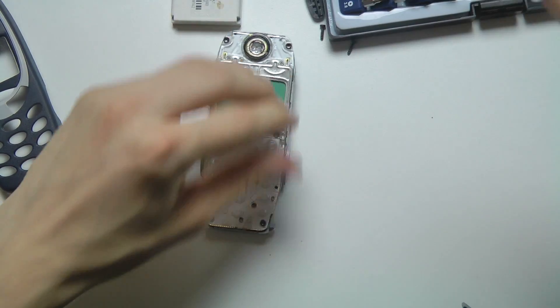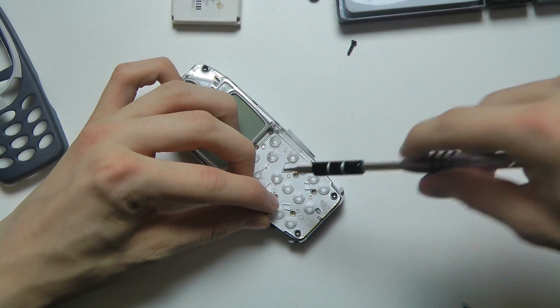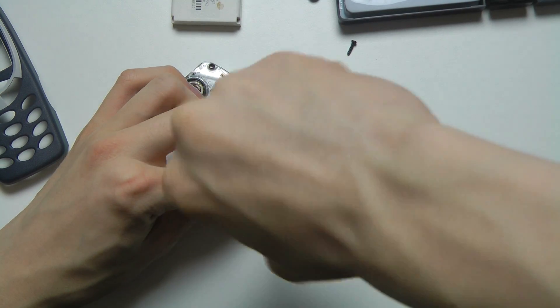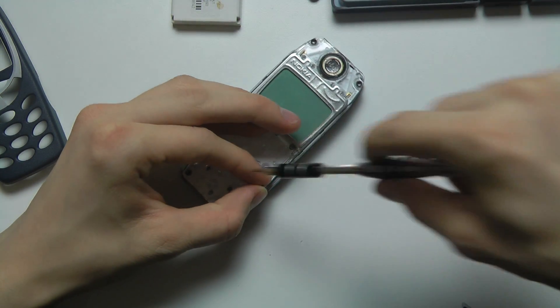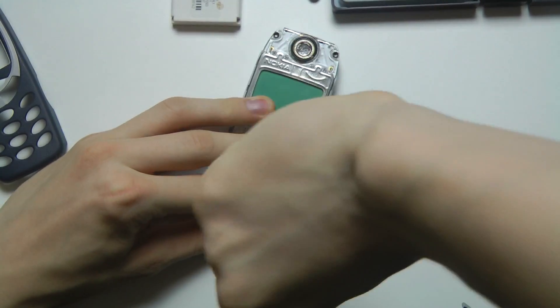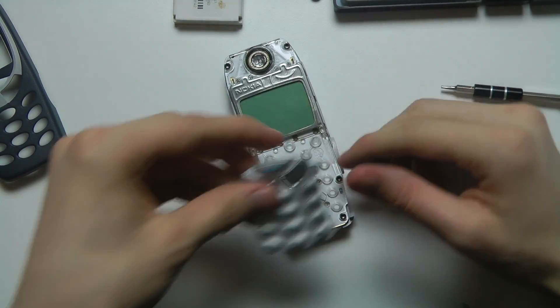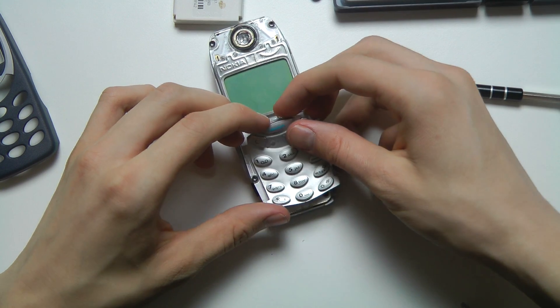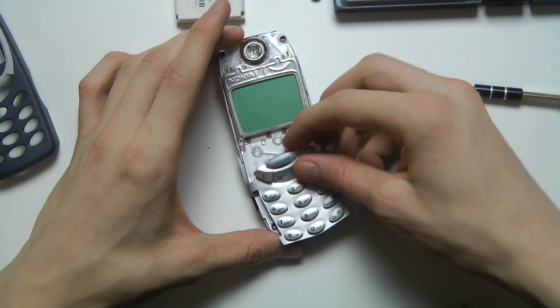It's only six screws you need to remove. I remember when I was trying to disassemble an iPhone — oh my god, don't try that at home, kids, that was annoying. Now with all the screws back in, we can simply put this piece on top, just align it in the holes, and you hear that clicking noise when it's seated.